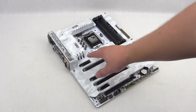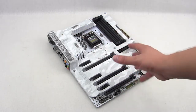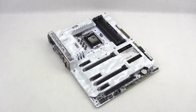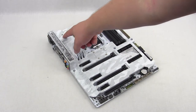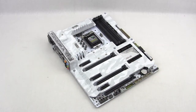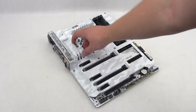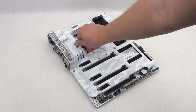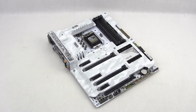You have these little air vents around the CPU socket and you can actually install two extra fans on the thermal armor itself — one fan goes here and one goes up here. They don't come pre-installed; if you want to use them you can, and they do come included. These vents can be opened and closed with little buttons right here, which will allow you to direct the airflow if you happen to use the fans.